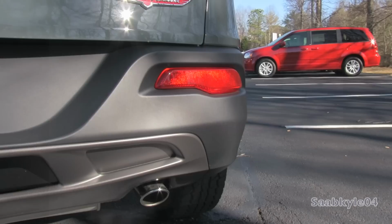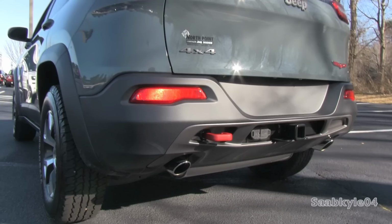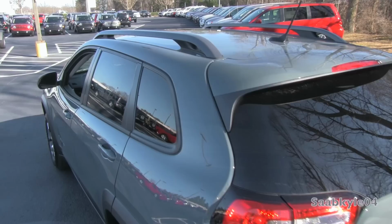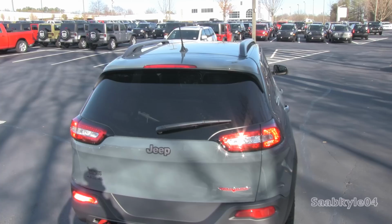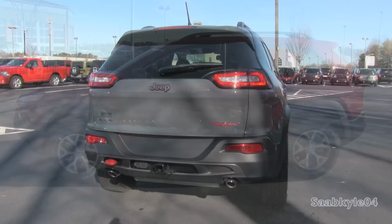As far as specs, the new Trailhawk features a 28.5-degree approach angle, 22.8-degree breakover angle, and 32.2-degree departure angle, all improving over the Liberty. It also gains 0.8 inches of ground clearance, which is now 8.6 inches. All four-wheel drive systems feature an automatic rear axle disconnect, which reduces performance loss when four-wheel drive isn't needed. Therefore, the drivetrain will not rotate while in two-wheel drive.